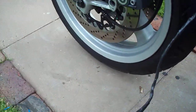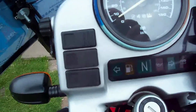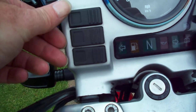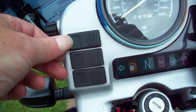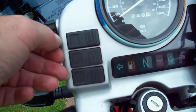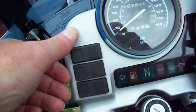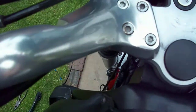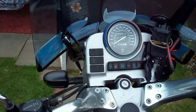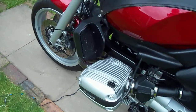As for the wiring — my intentions are, and I don't know if everybody has these bikes the same as mine — I've got a hazard switch and one for my heated grips. There's another switch at the top that I've had a look at — it's just a normal switch with no wires going to it at all. I don't even know what it's for. Maybe it was for the GS model — people could tell me. My intention is to wire this Kenlow fan to that top switch so I can manually use it when I'm sitting around in queues and hopefully keep the engine cool, switching it on and off as required.